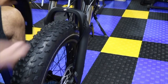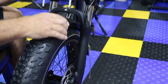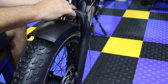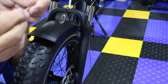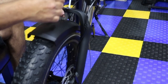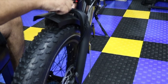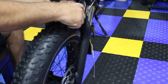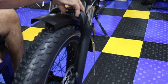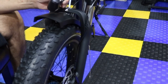Take your fender from the back side and slide it up through here. There's a plug — just move the plug out of the way. Move the fender up and set it here for a minute. You have a screw, a washer, and a nut for the front, and a screw and a washer for the back. Grab your light — it can go on either the back side or the front. I personally like mine on the back.